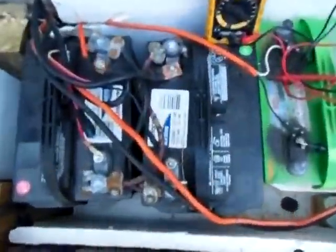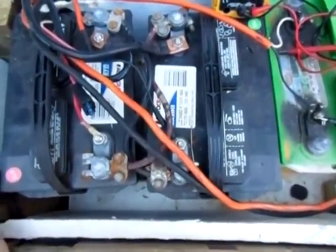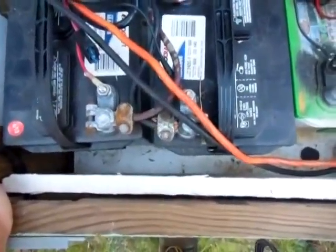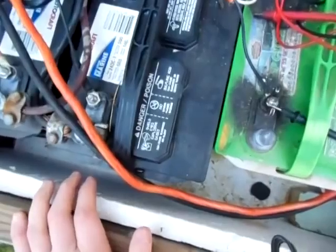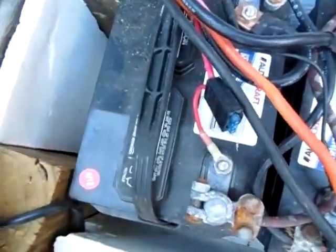Just a note: when charging batteries, you never want to charge a frozen battery — you will damage it. And most of the time you won't be able to really bring it back. The best way to check if it's frozen is to pop off the vent caps on your battery and see if the electrolytes in there are frozen.